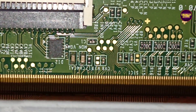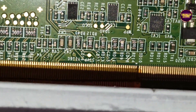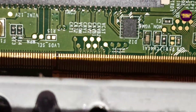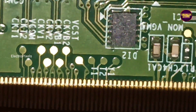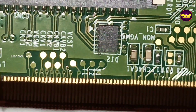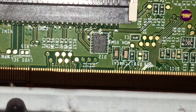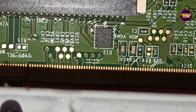So let's start the repair process. These are the gate signal tracks from both right and left side respectively. We are first going to cut down the right side gate signals and check if the picture is okay. Now the picture comes with a clear image without any flickering or double image — the TV is repaired successfully.